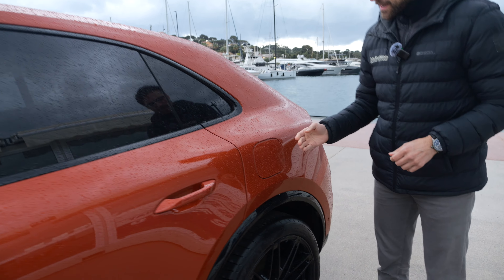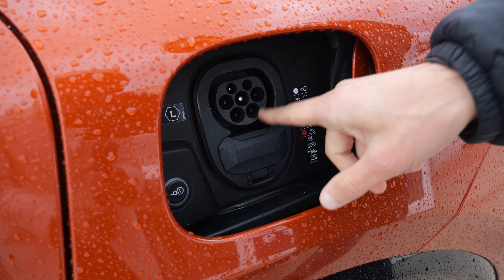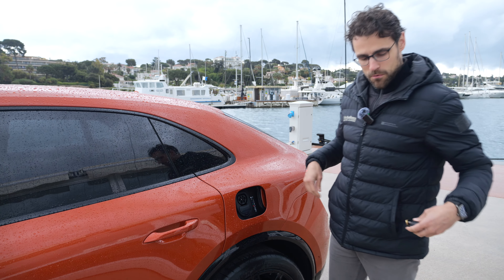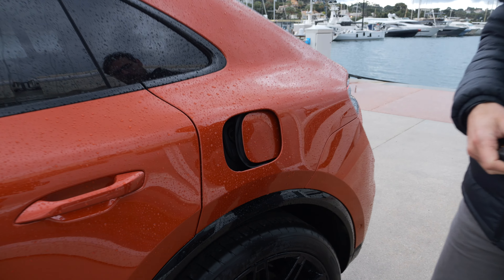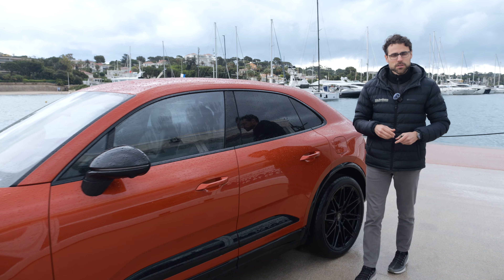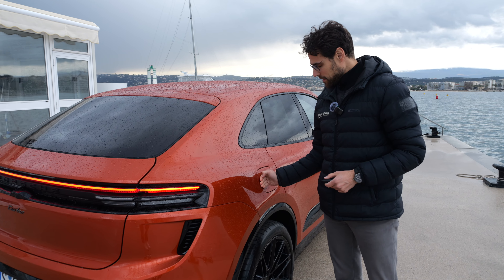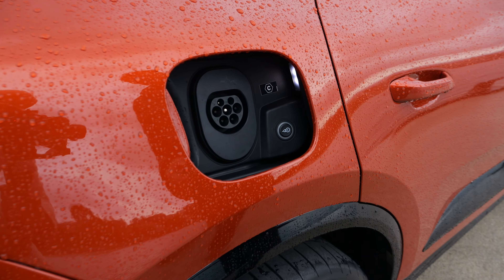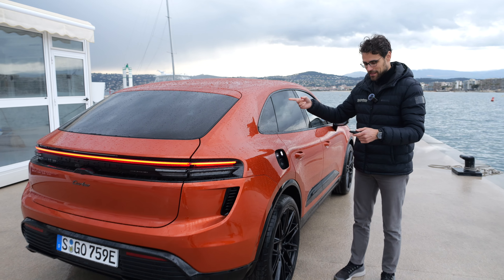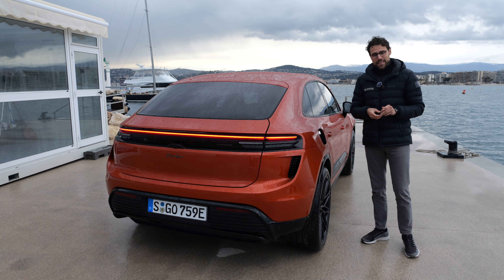Recharging is very cool here. The charging flap on the driver's side — you just hold your hand there and it opens as a sensor. 11 kW AC charging, with 22 kW available later. DC charging has a 270 kW peak. When you close the vehicle, the charging flap closes again. 21 minutes for 10–80% state of charge — that's massive — on 800-volt architecture, making it one of the quickest-charging EVs out there. There's also a second charging flap on the passenger side, sensor-operated, for AC charging only. Only one flap can be open at a time — you cannot open both simultaneously. The electric charging flap is an option; otherwise it has a standard cap-style opening.